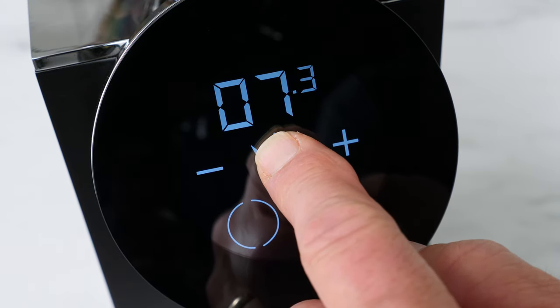Dose-to-dose retention measures how consistently ground coffee flows out of the grinder. I loaded each grinder with 18 grams and looked for large variations in the amount of ground coffee delivered. All three grinders did exceptionally well — doing the test five times on each, I never had more than two-tenths of a gram variation from the 18 grams loaded. These results are a little more consistent than those from my normal-use hopper-loaded time-grinding dose accuracy, probably because I'm not feeding from a full bean hopper. Bottom line: internal retention is a solid 50 percent lower than similar flat-burr grinders I've used. The LX grinder's internal grinding chamber is relatively small, the path from the chamber to the delivery chute is short, and the static and clumping control isn't as restrictive as on many grinders. If a fresh and consistent dose is important to you, these grinders are top tier.